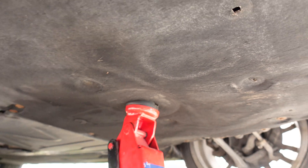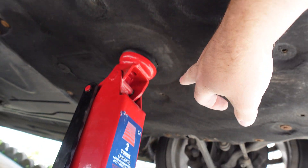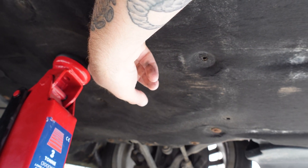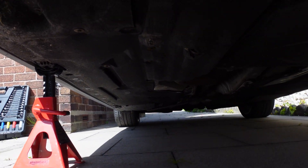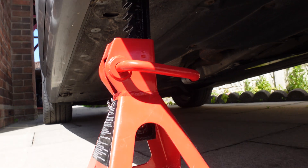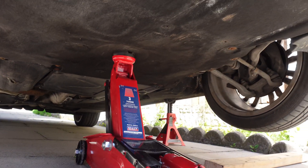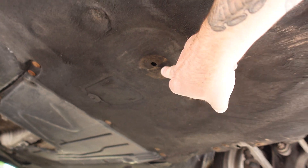Car's jacked up now and I can show you this centre jacking point. This flap here is the access to the sump plug, and then in front of that you've got three holes in a line — it's basically the centre hole there. Once you've jacked that up, position your jack stands underneath the car. Be careful that when you drop the car back down you're not going to hit the skirt. Make sure they're the same height and then you can drop the car back down.